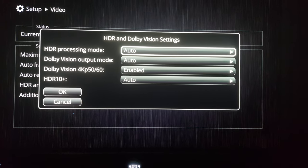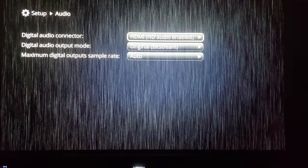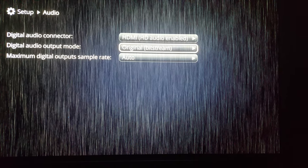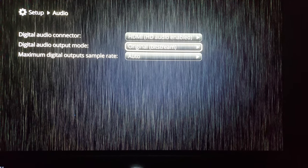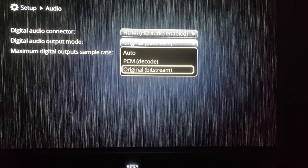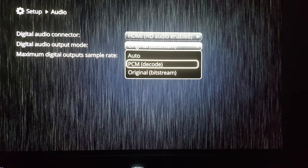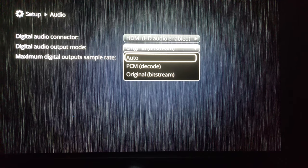You can customize this to a T. Additional settings are all there. I'm just showing you a quick breakdown. Now, if you have your stuff plugged directly into a receiver or a soundbar, then Original Bitstream is the option that you want to go with. However, if you're running it directly to the TV and your TV may not support all the audio formats, you'll be fine with Auto. If it supports Atmos or DTS-X, it's going to automatically select that based off of the Auto configuration. I either use Auto or Original Bitstream.